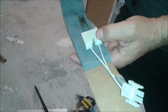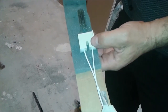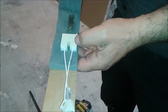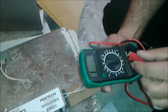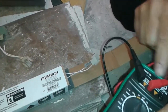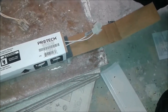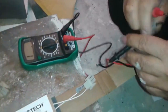Now I will tell you, don't touch it — not because of the oil on your finger, but you might break it, it's very very sensitive. So let's check the resistance. The first thing I want to check is to show you how I'm checking this igniter to see if it's okay. I put it here, you can see it's set to 200 ohm, because I expect the ohm to be between 50 to 200. Here is the ohm meter. Look where the igniter is inside, because I want to protect it. To test it, I don't really need to take it out of the box — I just need to test the two points, the two connections.